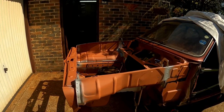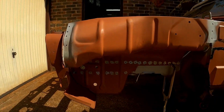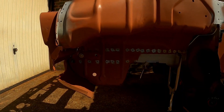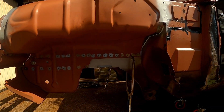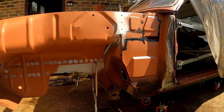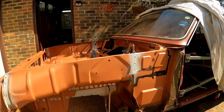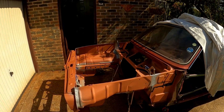Ideally I would have skipped the primer step until after I had all the panels welded on, but in this case I knew the shell would be sitting outside — albeit under a cover — so having as much of the body protected with primer as possible before welding day meant I only had a few areas to touch up before sundown. So once I got all the holes drilled for plug welds, the panels clamped where they needed to go, and on a nice sunny day, I cracked on with the welding.